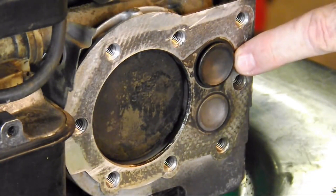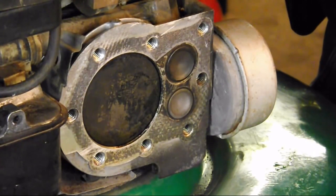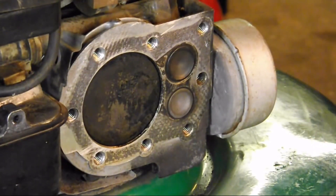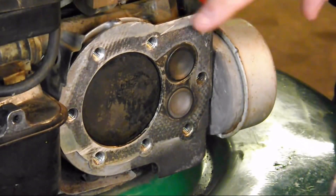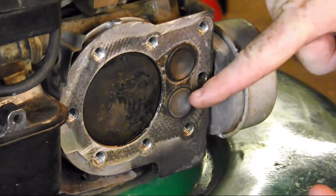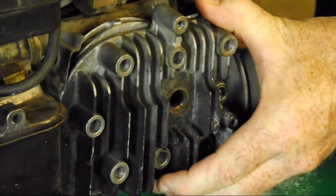That's right — the intake valve is going to open again and the series continues. Now let's put this knowledge to practical use. Say you found a rototiller or a riding lawnmower on Craigslist and wanted to check how much life is left in the engine. We can use a simple but advanced diagnostic tool. Pretend the head gasket is on and the head is bolted to the engine. We're at top dead center of a compression stroke — both valves are closed tightly. We would remove the spark plug and put compressed air into that port.